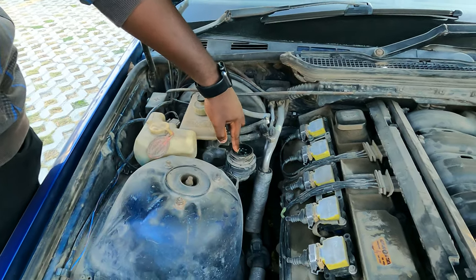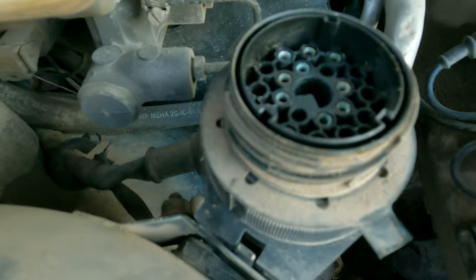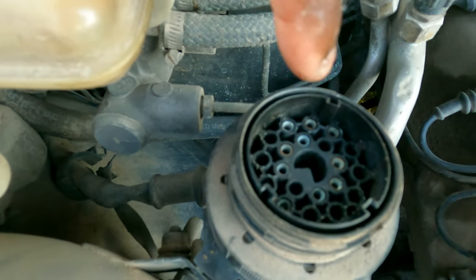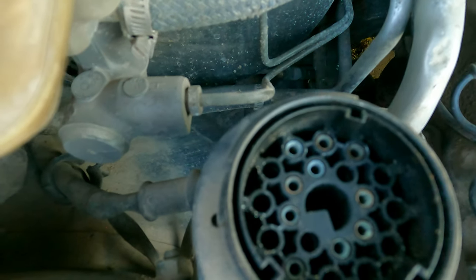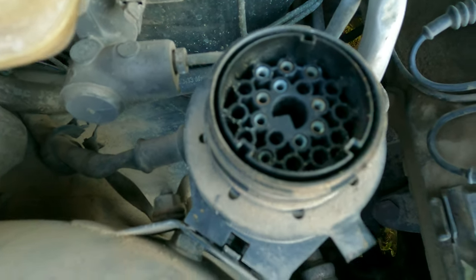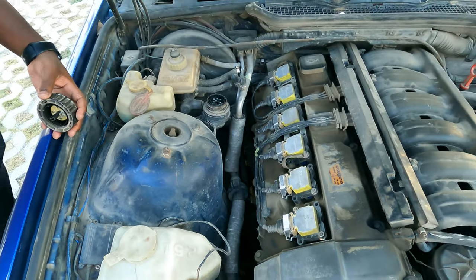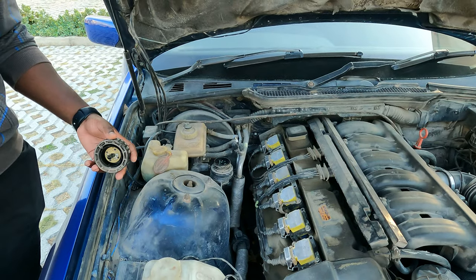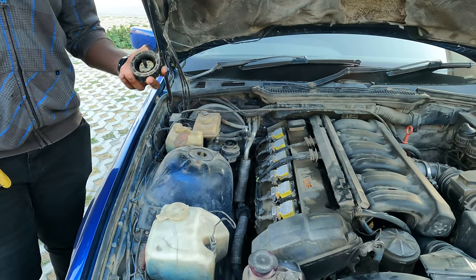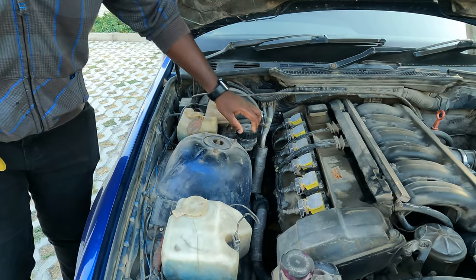So this is the port. We already have all the wires. The BMW is a 20 pin OBD port, so there's a cable that converts it from this to the normal 16 pin OBD. We already use them. We read the car, you can tell ignition on versus battery on and stuff like that. But I just can't get it to pick up live readings. Let me see what I have at home that might be able to do that.